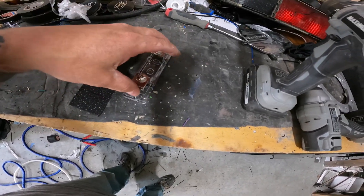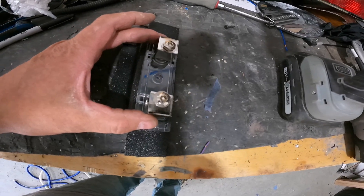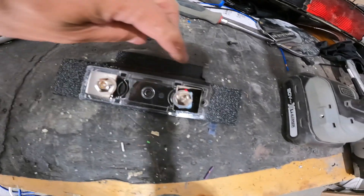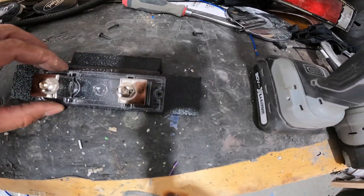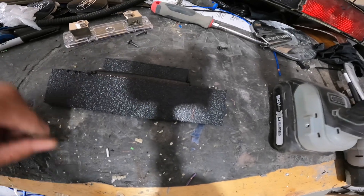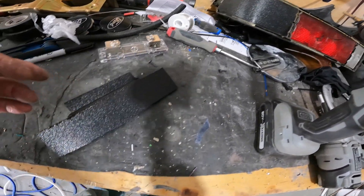Here's what I'm playing with — there's the fuse holder, and there's a rough shape for our mount. That's going to sit right there like that. I still have to clean up some edges and round it over, but this here will bolt right to the battery box of the truck. Clean up the edges and we'll have a nice solid fuse holder mount. I'm going to get working on that — and while I do that, go click the subscribe button, hit like, and let me know what you think of this install so far.